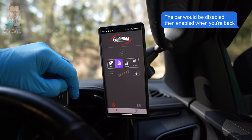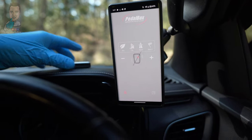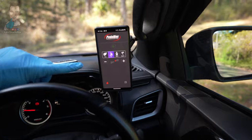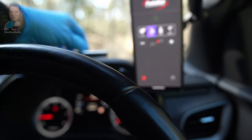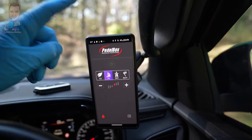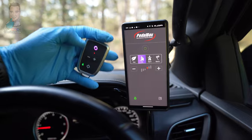Let me give a quick demo. I'll disconnect the remote, wait for it to update — there we go, it's disconnected. Now I'll start the car and show you: I'm pressing the pedal down and nothing is happening — we're not accelerating. Now it's just picked back up because it recognized the phone. Either the phone or the key fob will wake it back up. So essentially you can have a second layer of immobilization where the pedal simply won't work until your phone connects or you wake up the key fob.